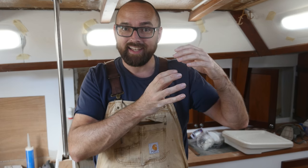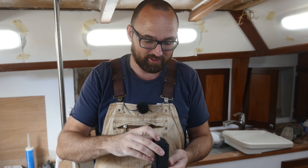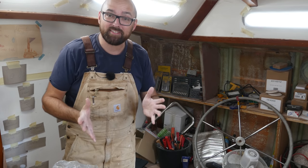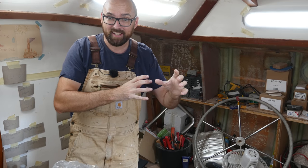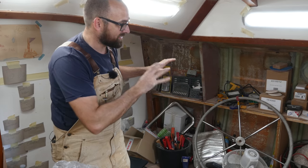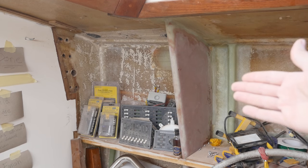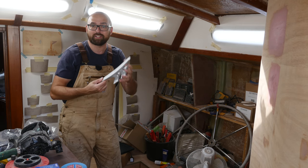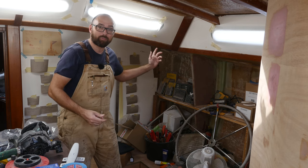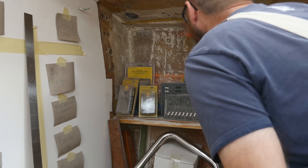Nothing is ever as simple as it sounds because the surface I'm going to be bolting those little brackets onto is not flat and not uniform — it varies throughout the length of the deck. So I'm going to have to use a little digital level and grab a bunch of measurements. That doesn't sound super annoying until you realize I need to figure out the position of each and every one of those brackets, and there are some things inside the boat I don't want to mess with — the bulkheads and the knees. I don't want a bolt from the brackets located inside a knee. Last week I drilled and filled a bunch of holes for Athena's future cleats, which are visible both inside the boat and up on deck, so I can use those as a point of reference — measuring the distance from one of those holes to the bulkhead and also to the knee.